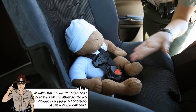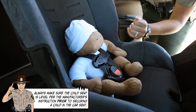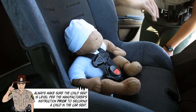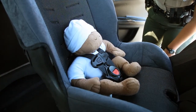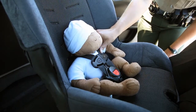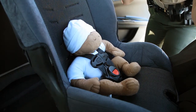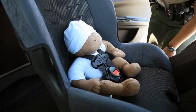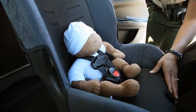The next step is to put your seat cover back down into its position and then properly harness your child in the car seat. Once you have the child positioned, make sure the bottom of the child is completely back towards the back side of the seat and that the straps sit at or below the child's shoulders. The chest clip should sit at armpit level. To make sure the straps are tight enough but not too tight, check at the shoulder level to make sure you cannot pinch any extra. You don't want the child's shoulders to be compressed by the straps — just tight enough that there are no loose straps. At that point, you know your child is safely secured in the harness.